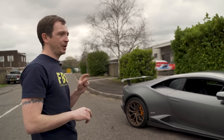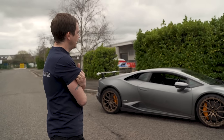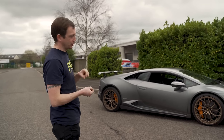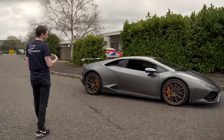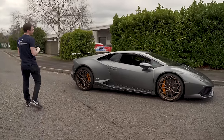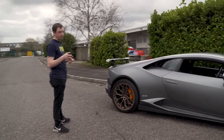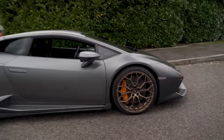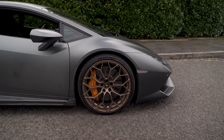There's no adjustment in camber front or rear, so you have to shim it. We sell shim kits for these, but there are no eccentric bolts like in the Gallardo or the Gen 1 — it is purely done on shims. The Huracan has nose lift as an option; not all of them do, but the R8 does not have nose lift. This one has nose lift functionality and it sits up in the front under the scuttle.